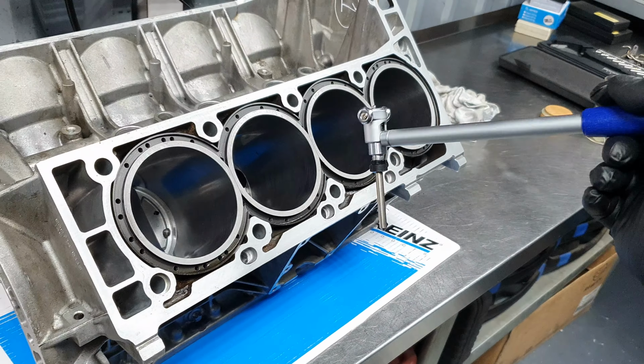Nothing more, nothing less. The crankshaft, it was straight. It was not bent. It didn't have any problem. It was zero. I sent it for polishing. I can use the crank, but not on this engine as it is right now. All right. That's what I have to say. I hope that I cover you.